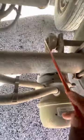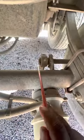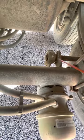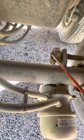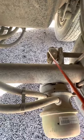Back here behind your brake chamber is your push rod and slack adjuster. They're properly mounted, secure, not cracked, bent, or broken. All bolts are present and on tight, held by pins and keepers. And with the brake released, there shouldn't be more than an inch of play.